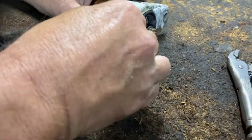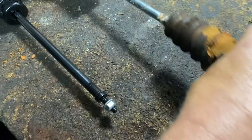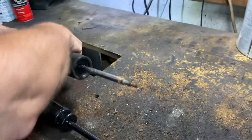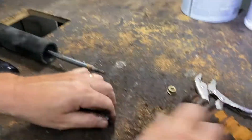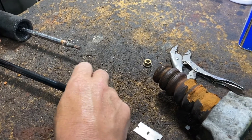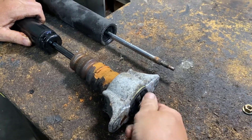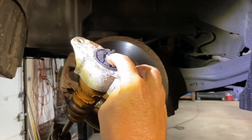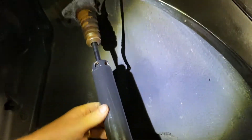Now all you've got to do is transfer the top mount. This is the 13 millimeter — you take it off and take this off. This thing had a sleeve on it, but it doesn't, so you take the mount and basically you just put it back on and push it on. You take the new bolt and zip that down. Then you're ready to install it. Tighten the 13 millimeter, and now all you're going to have to do is install it the same way you removed it.